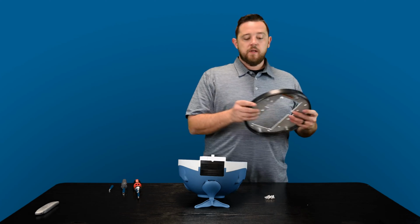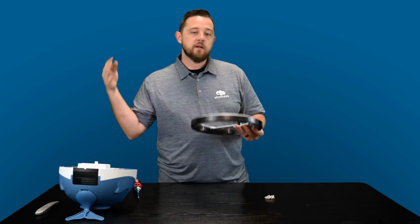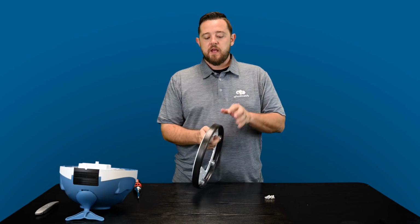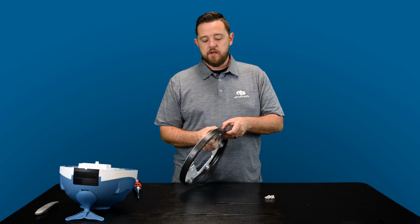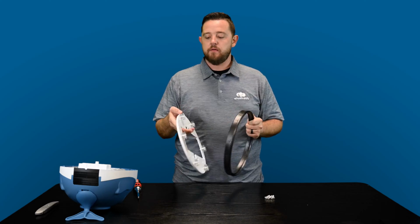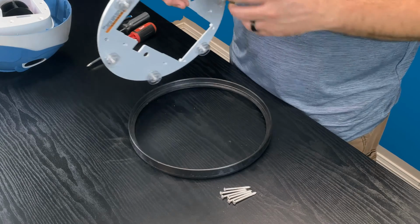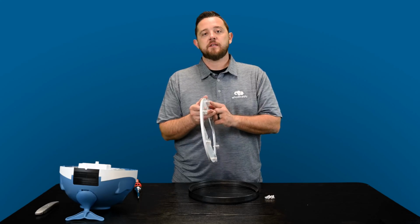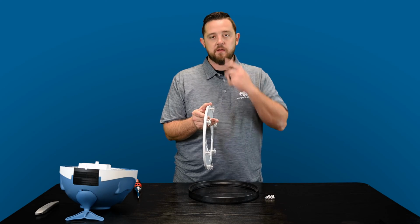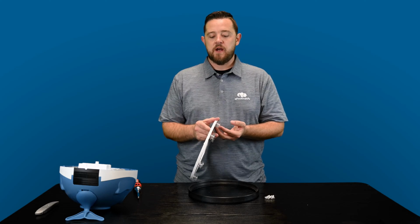Really simple. I want to show you how to take it off, and more in depth into the cleaner will be a future video. But when it comes to the actual outside black ring, you don't necessarily have to remove this entire plate, as you can gently lift this around these pieces. I highly suggest you only do this if it's a new cleaner. If it's a few seasons old, only plastic is holding in these little wheels. They're almost like a free spinning bearing. So it's only plastic, and if you pull too hard, these can get really brittle and fragile and snap.